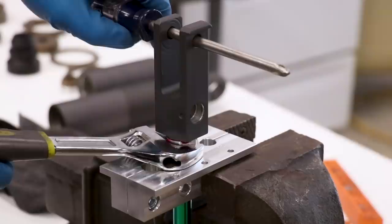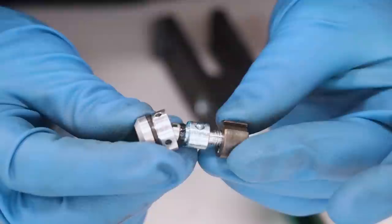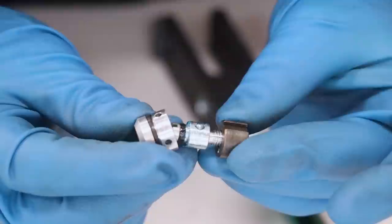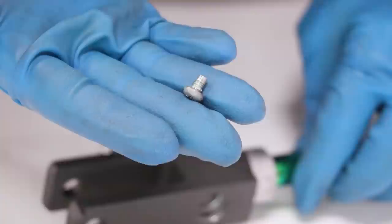Next up we have the rebound adjuster. You want to make sure all the previous markings from the locking screw are filed down, otherwise the adjuster won't fit into the clevis very well. While you have the adjuster off the clevis, it's always a good idea to clean it up and re-grease it. Put the guide screw in on the bottom — this screw is what guides the adjuster into place — use a little bit of blue Loctite on it.